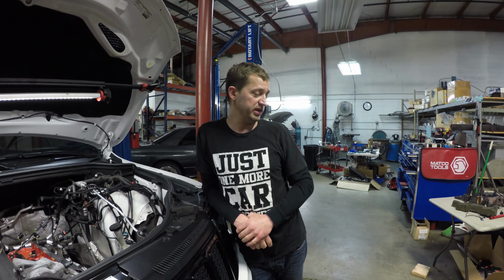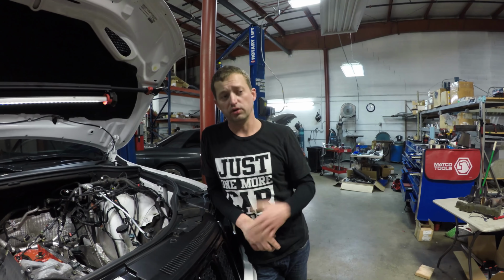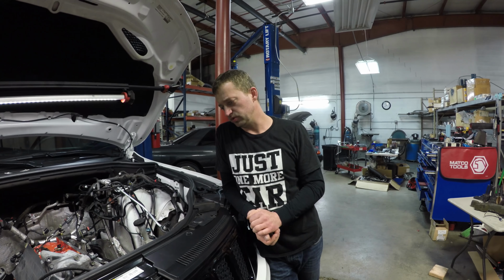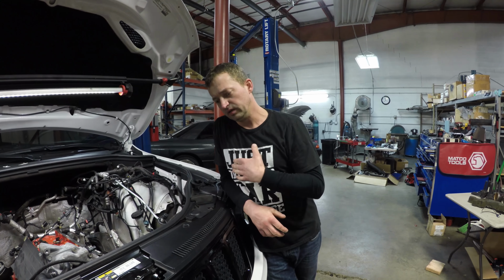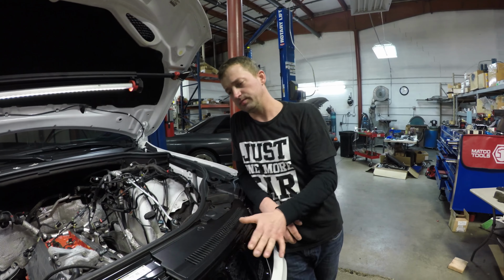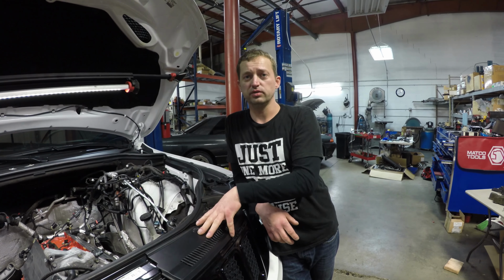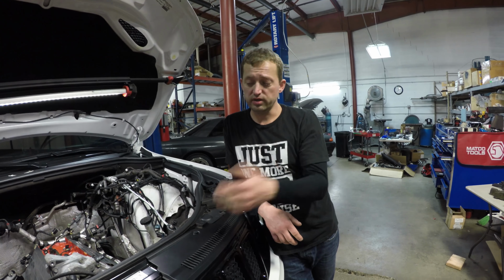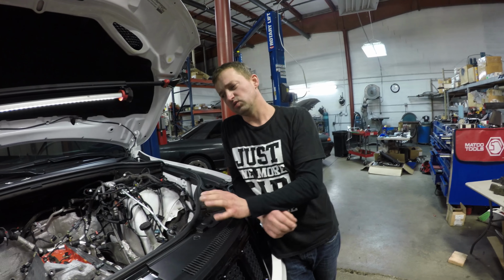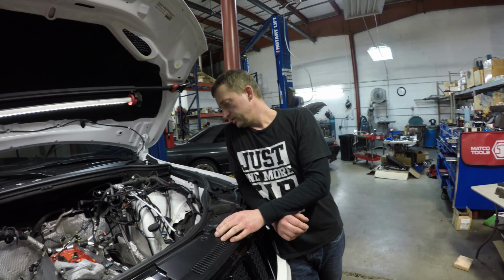Tim's truck made 840 to the tire and 920 or 915 on Adam's dyno too, by the way, which is a very low reading. Yours was at 14.5 pounds of boost. We've gone up to 15.5, but then we made no more horsepower, a little bit more torque, and the intercooler temps got up. So the kit that we give out will support 1,000 engine horsepower. Sure, which is 840 wheel horsepower. It's a little bit above. It's a 20% drivetrain loss then, roughly? 24 percent on these, because of all-wheel drive. It's quite a bit. Okay, cool. Well, that sounds awesome.